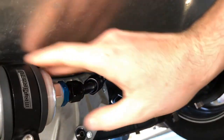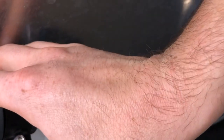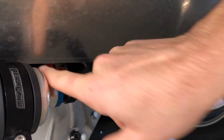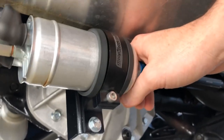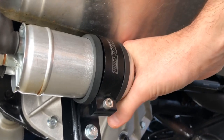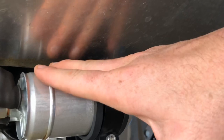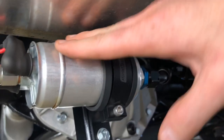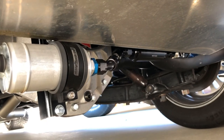This pump could be at the level of the bottom of the tank — that'd be okay if the pickup was right there — but I wanted it down below because I had a little bit of room for it. There wasn't as much room to put the pump up higher with the rear end. It's a three-quarter-ton truck, so it's a little tight back there with the pumpkin. I've got it situated correctly here and I've had no problems with this setup — it works fine.